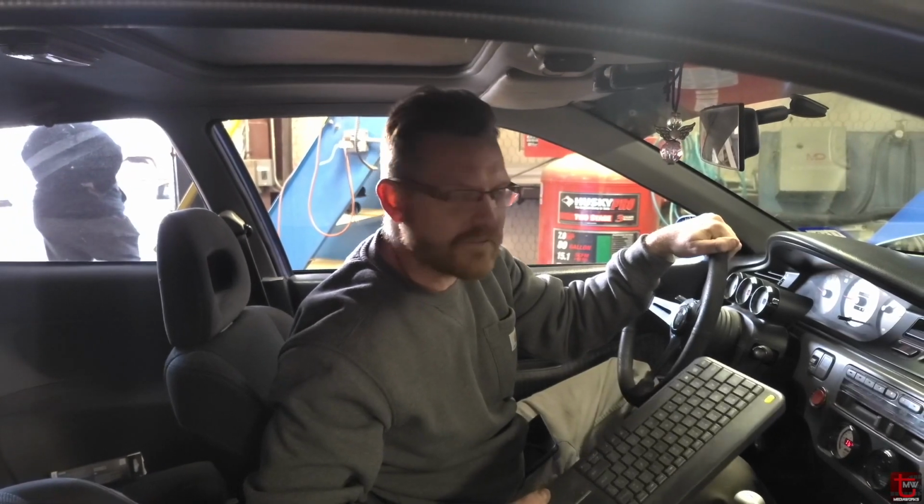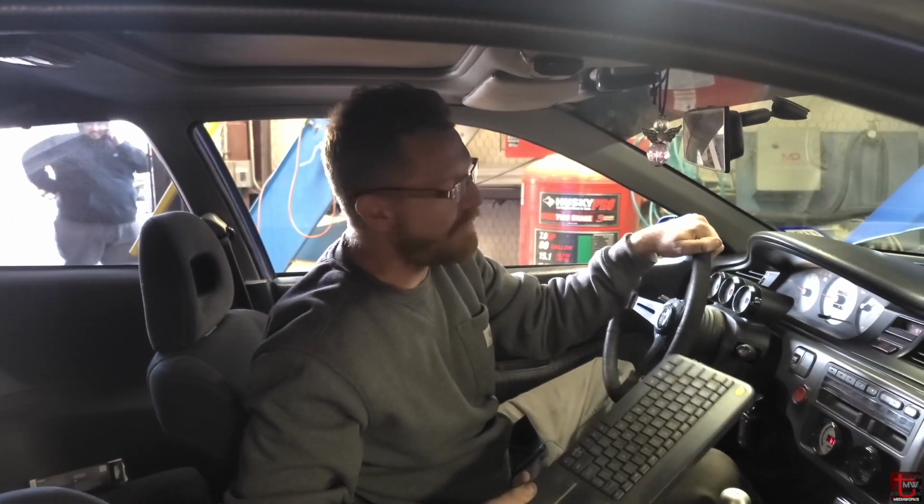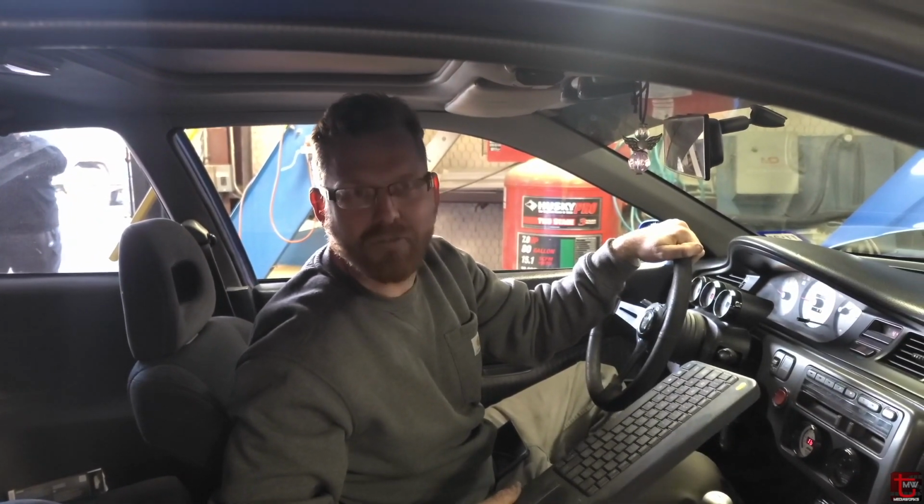I won't do that. Did you say 10,000? I won't do that. No, like we could. So what realistically are you going to set the rev limiter to on this? I like 8,800 as a peak for a car that's maybe a weekend car or something like that. If it's driven daily, I like 8,500 or so.